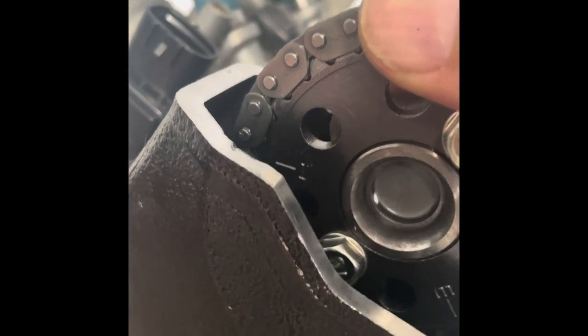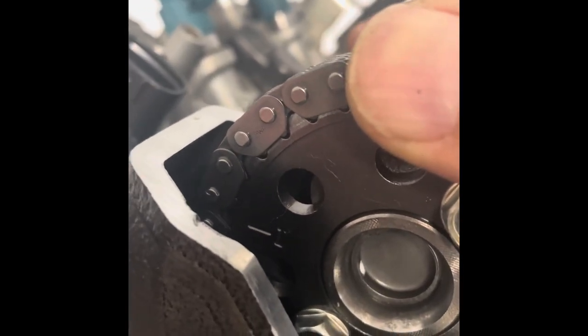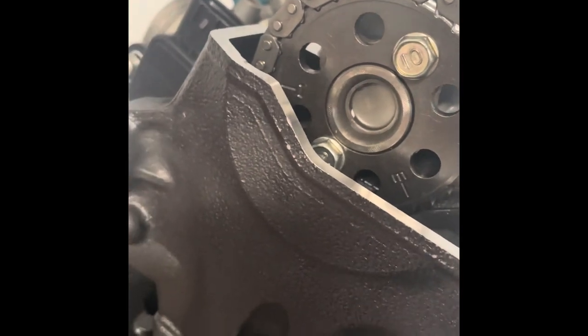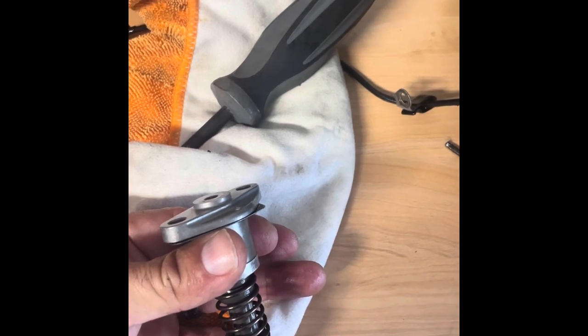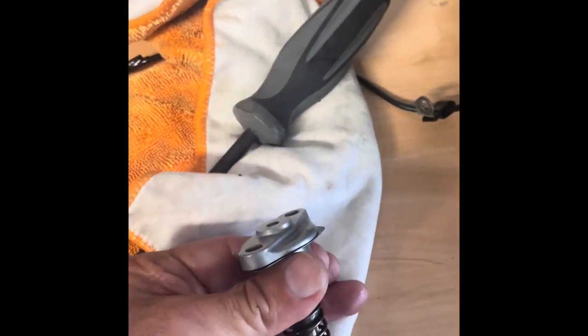Now you can see that mark is clearly under the surface. I'm going to put the intake cam cap on and torque them down. The intake cam is torqued down, the exhaust cam is torqued down, the lines are where I want them. Next I have to install the cam chain tensioner. These are the automatic feed stock ones — they have a fair failure rate on pretty much every manufacturer's bikes, but I like to stay with the stock ones for ease of maintenance; they're not that expensive, so if one fails I just replace it with another stock one.